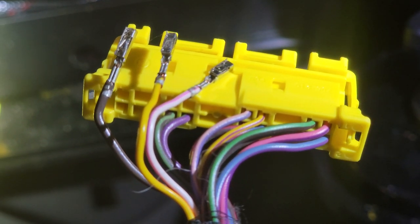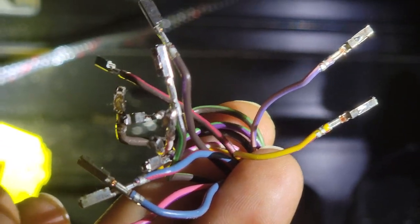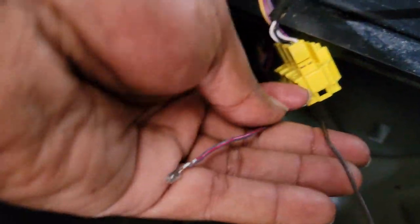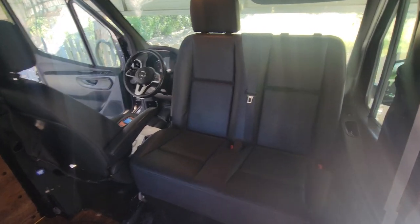Making slow progress — I got about three pins out and there are still around ten or eleven to go. I was able to de-pin the connector with no damage to the wires, so I'm routing it through that hole and then through this one to connect and mount it here. I got most of them routed — just two more left. I applied some grease to make it easier. Now I need to check for any friction while rotating the seat and look for any sharp edges that could damage the wire.